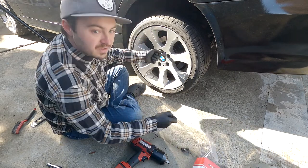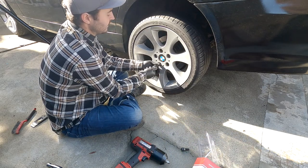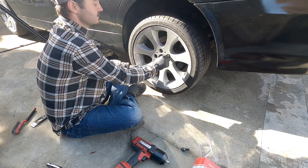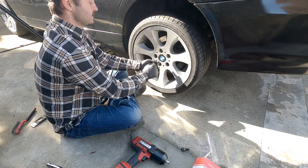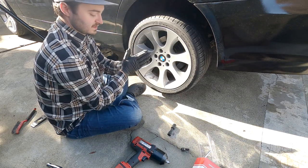And it's like, you pay for what you get, you know? High quality kit, spend a little bit more money, better quality in the end, right? So we're gonna go ahead and snug all these down, just like I put them in, in that star pattern. Make sure everything's even. So we'll check this, there's no wobbling. That means everything's seated flat, sandwiched together.